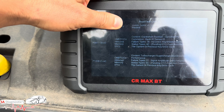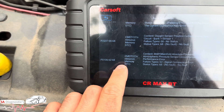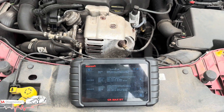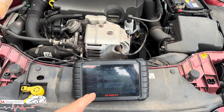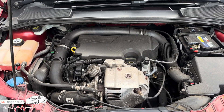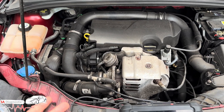Welcome back. In this video we're going to go through this fault code — the P0106, called the MAP manifold absolute pressure sensor. If you have this fault code, and it's just that one, on these one liter EcoBoost engines, the signs are: you'll go into limp mode, you'll judder, and it'll probably not work as it should.